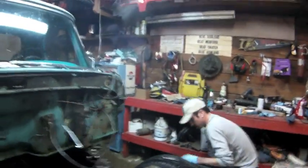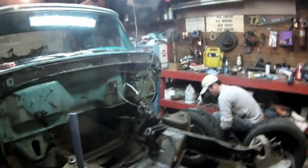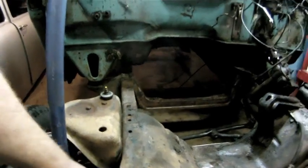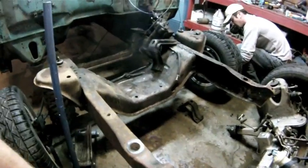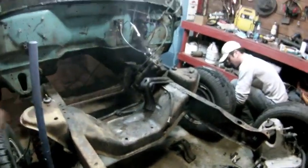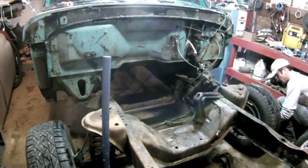Well, it's a pretty common fit to retrofit this, and it just happens to be that these alignment pins that you'll see here actually line up to the same as the center rail on the frame. So what we're going to do is cross brace this front here, which I'll show you in a little while. We'll weld a piece on there so that when we cut this whole front end out, it doesn't move the rails at all.